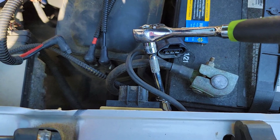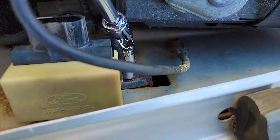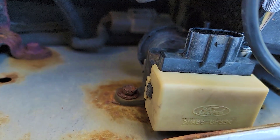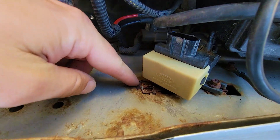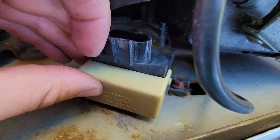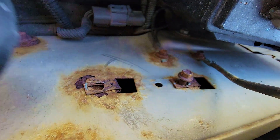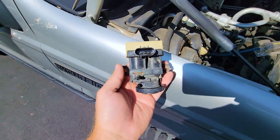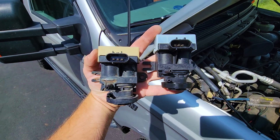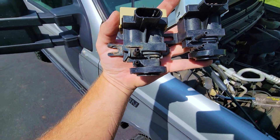So we've confirmed power and vacuum going to the switch, but vacuum was not passing through to the hubs. The next step is to go ahead and replace this. Luckily all you have to do is loosen it because it will slide out — you do have to fully remove one bolt, and they are eight millimeters. As rusty as that screw was, it did come out. There we have it — a good view of the new one and old one side by side, and it definitely looks like a match.